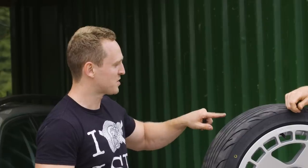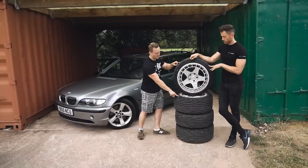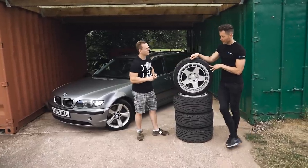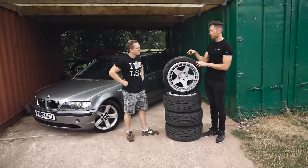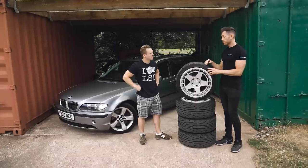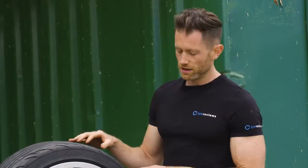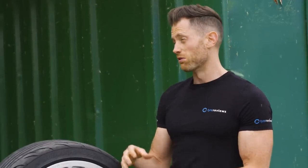When I asked you which tyre sizes to get, you said go for staggered. So we've got 225 here for the front and 255 for the rear — why is that a good thing? BMW from factory offer both the square setup with 225 all round, and the staggered option for the more high-power cars. As we're going to add loads of boost and power to this beast, it seemed a nice idea to get back to the original staggered ethos, which will give a bit more grip at the rear.